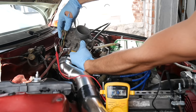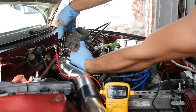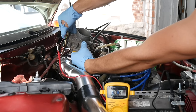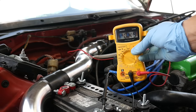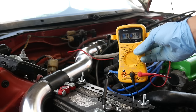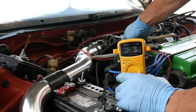You're going to just slide your TPS back and forth so you can find 0.5 volts closed and as close to 4.5 volts open as possible — it may not be perfect. With your throttle position sensor fully closed we're shooting for 0.50 volts, and fully open we're shooting for 4.5 volts.